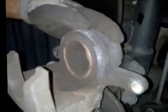Basically what this is going to do is allow the brake pads to fit inside of there, or it's going to go over the brake pads with no problem. Look at how nice and flat this is. That's going to be your major problem if you don't compress that, because there's no way to get it over your brand new brakes.